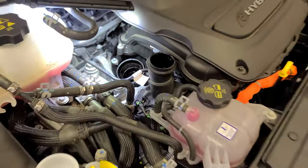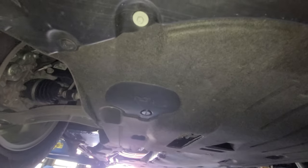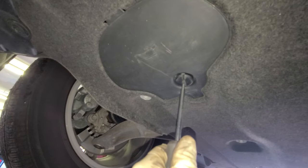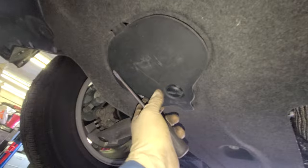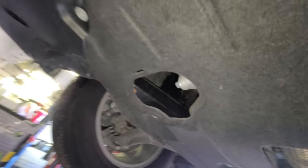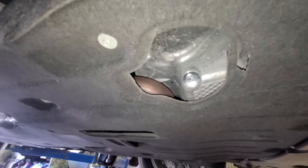Let's go down there and drain the oil. I just gotta turn this to expose the oil drain plug. Let me get that thing — there you go. You can remove this for now. There's your drain plug right there. Coming through — 13 millimeter.